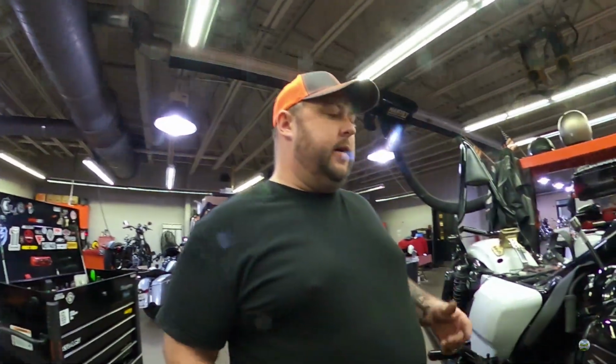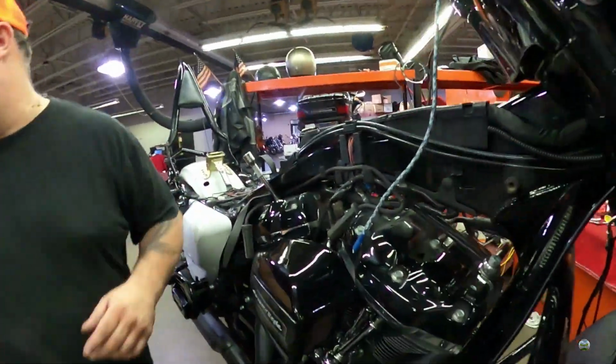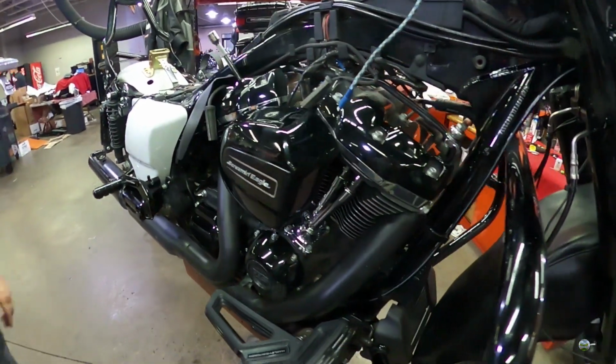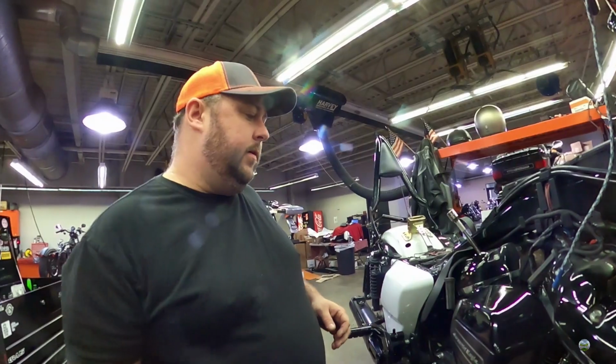Exactly, headers especially. Before you pull the plugs out, you want to make sure you blow out any debris, because if you look down in here, with a light, you can see it. You want to make sure all of that is sprayed out with air. It goes right into the cylinder, right above the top of the piston.